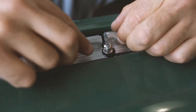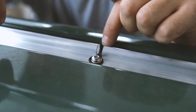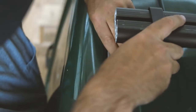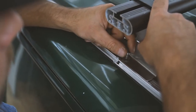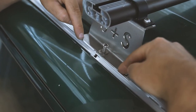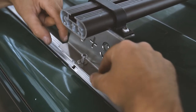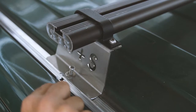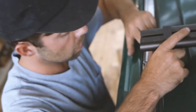This will sandwich between those two. You might think it's a crazy big gap, but I guarantee your awning will still pass through there absolutely flawlessly. If you're struggling to find a rail to work with your roof bars, you can quite easily grind that high bit off of the rail itself, have a big gap in the track, and your awning can exit the track there, go around and in. It's really easy to modify the section of your track.